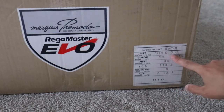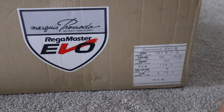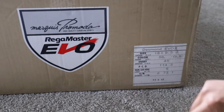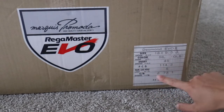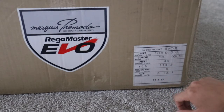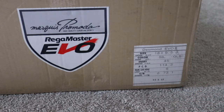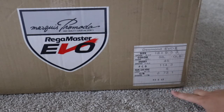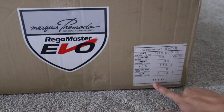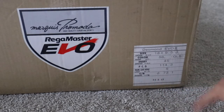The size I went with is an 18 by 9.5, just gloss silver in terms of color, and then a 45 offset. Obviously PCD is 114.3 and then a 5-lug. The center bore is 73.1. The other thing we can note is that it's stamped with the actual production date — this is 2022, February 17th. That's when these wheels were manufactured.